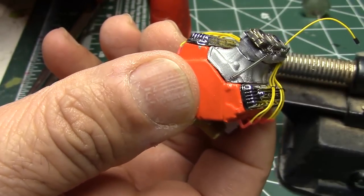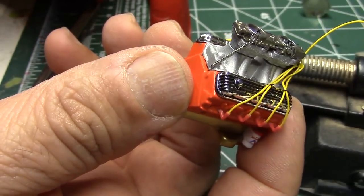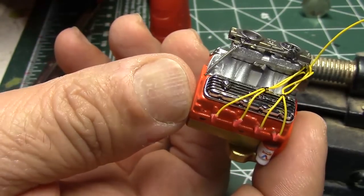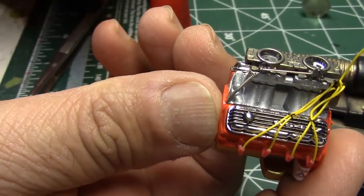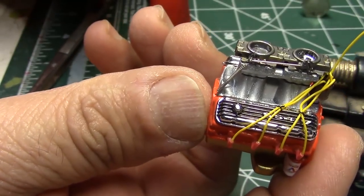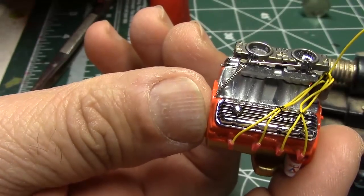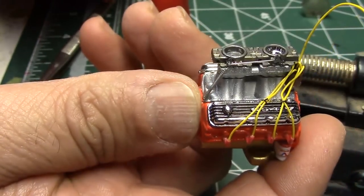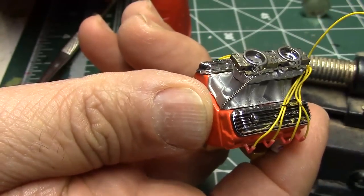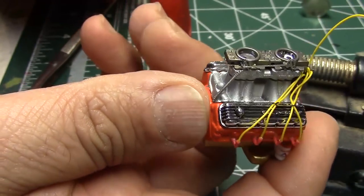Simple as that. It just takes a lot of patience, and just keep working at it. But it's neat how the things you wouldn't even think about, like who would think of getting a carburetor return spring off of a string from a guitar. That is what I use for making carburetor return springs. And there is my carburetor linkage.